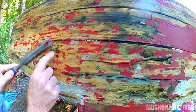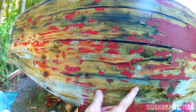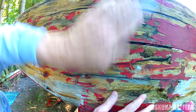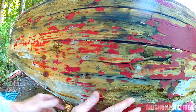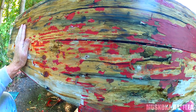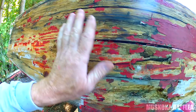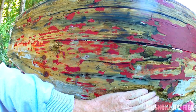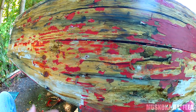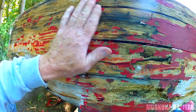As you can see, parts of the transom here are kind of punky - a little bit of dry rot going on. Right in here I've got a huge hole, and I think that's because the motorboard support plate on the inside somehow came loose and put everything out of kilter. I really want to avoid replacing the whole transom because then I'd have to take off all the stringers and the top decking. So I'm going to sand this down, fill it in with high density epoxy filler, and then sandwich another quarter inch piece of plywood over top. Hopefully I can salvage this thing.